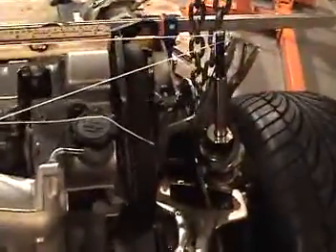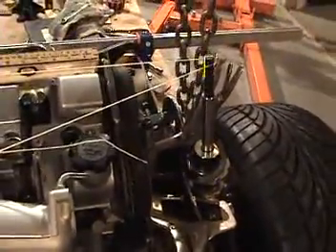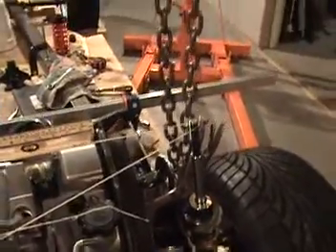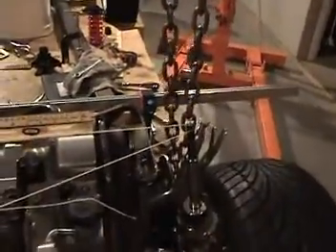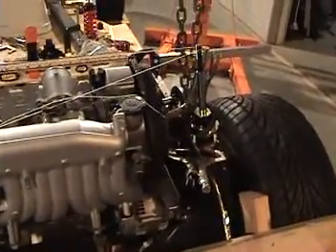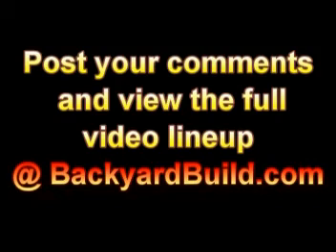So I'm going to do the same thing on the other side. As soon as I build my brackets, I'll bolt them through the motor mount, hang it with the chain again, and lift the motor until it just comes off its blocking, then tack weld everything in place.